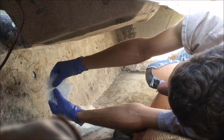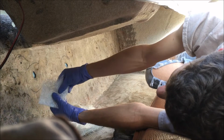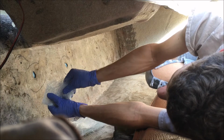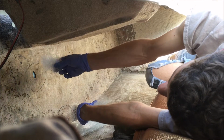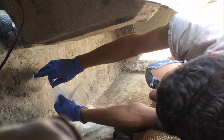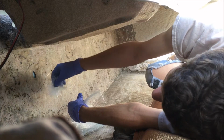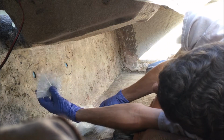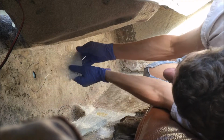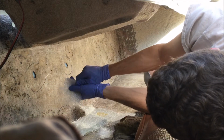And so for, say, this big hole here where the engine mounts to, I'm going to take a piece pretty much the same size as the hole, a little bit bigger, and that'll be my first piece, and I'll make sure I stuff it in there real nice. That's what you want your tape back there for as well, so the fiberglass doesn't just fall out the other side. And then the next layer will be a little bigger, doesn't have to be exact.